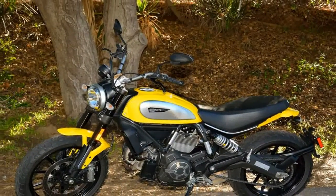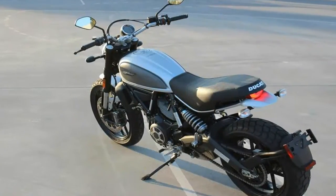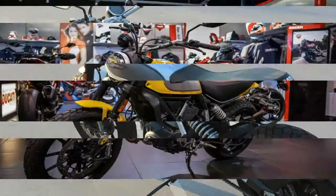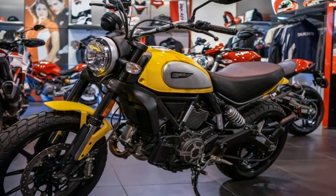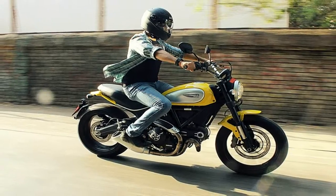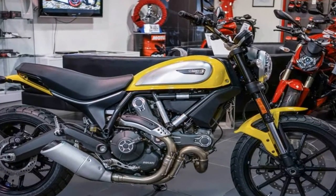As cool as the rest of the bike is, it's really just a setting for the gem that is the power plant. Ducati's L-twin — really a 90-degree V-twin — uses Ducati's famous desmodromic valve system to time the two valves in each head. It uses a push-open cam for each valve. Nothing special there, but the pull-close cam makes this into a different animal entirely.